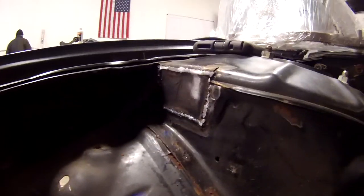Let me go over, while I'm sitting in the engine bay, what was replaced rust-wise. Here on the passenger side, on top of the strut tower, you have this little filler plate right here. There's a small piece of rust there. On the bottom, as it turns out, the strut tower was separating from the frame rail. So I rust-proofed it and gave it this little filler piece here.